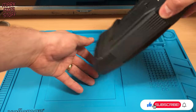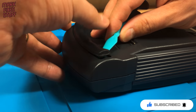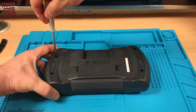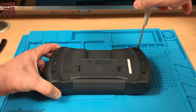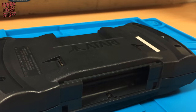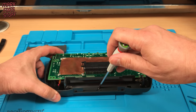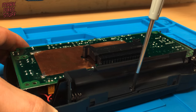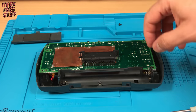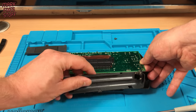Let's get this Lynx open. First we need to remove the rubber grips if your Lynx still has them. I'm using a plastic spudger so I don't tear or cut into the rubber. There are four outer screws on the back. Removing the battery compartment cover allows us to lift off the back of the Lynx. This gives us easier access to the screw securing the battery holder. Next, remove the plastic battery holder by lifting the main board and unhooking the right side from underneath the battery contacts.